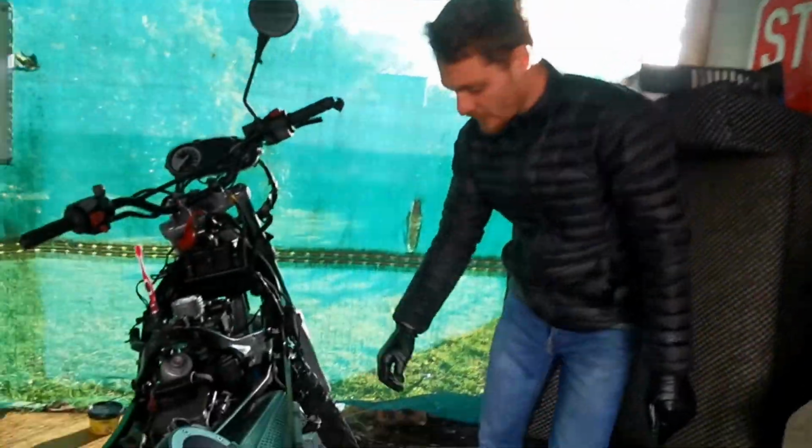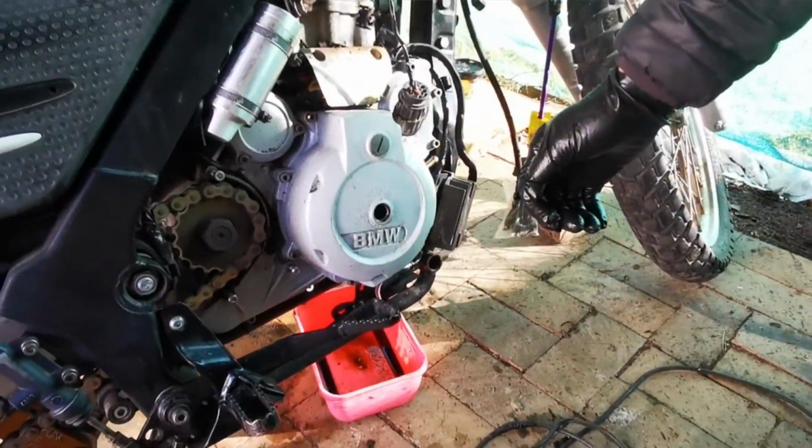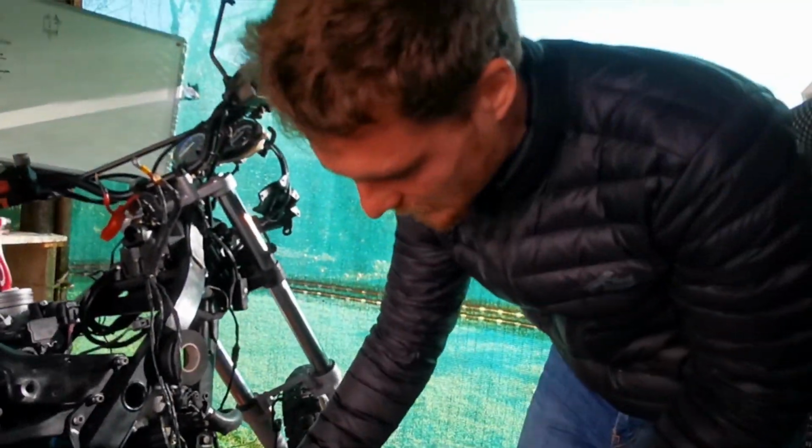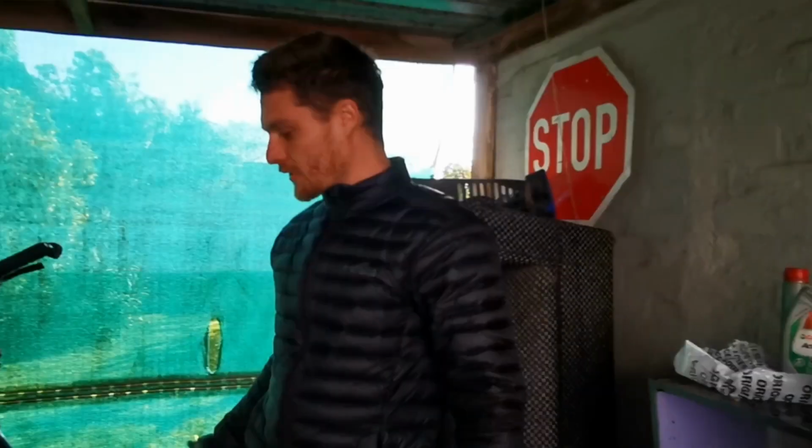Once you've got it in there, come back and try and turn your engine again. You'll feel if it's been stuck or not. If it's not, put it back into TDC and just try again. It's really not that hard. I think I only had 2 attempts and then I got it right. So now you've locked your cam.